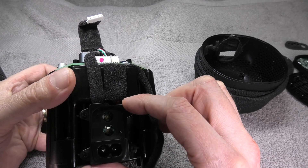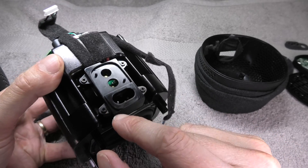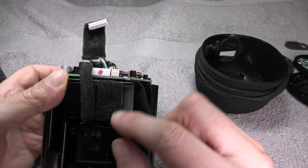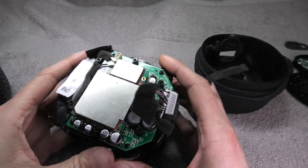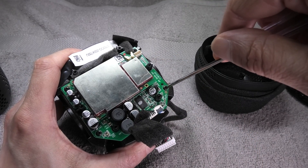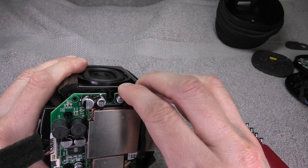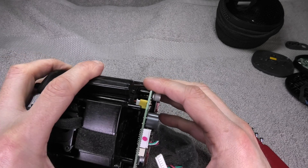There are a couple more wires attached to the motherboard going down to the side — that's where the two buttons for mute and Bluetooth are. Underneath that is the connection to the power supply. The next thing we can do is remove the main motherboard — there are four more screws holding it in place.